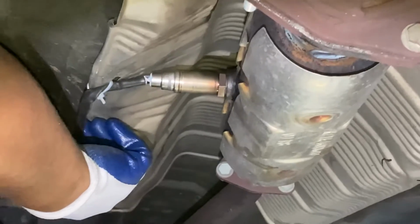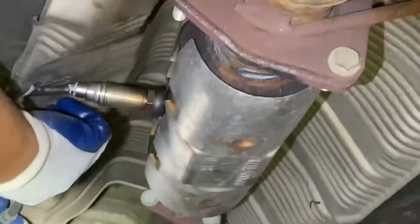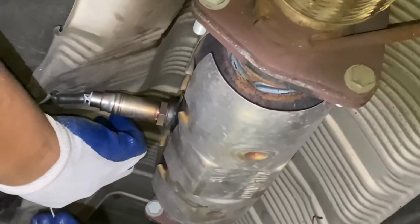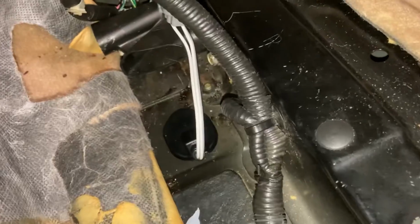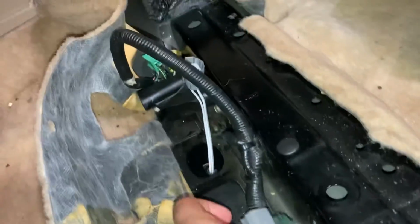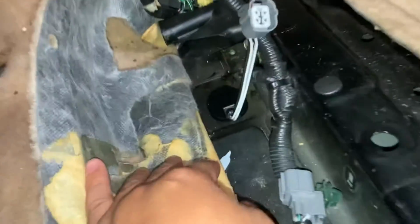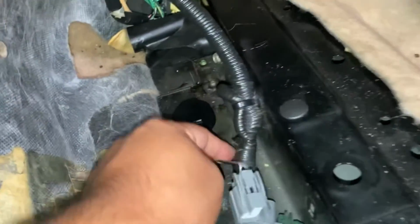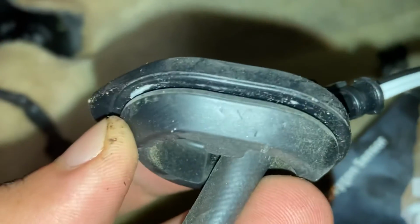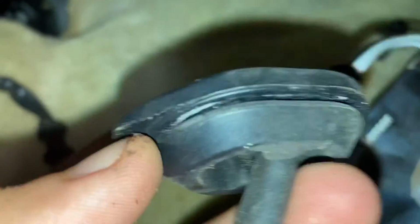I think you use the wrench, I think size 10, like the battery. Yeah, it depends on the car, probably. But you just put the zip ties and that's it. After zipping this, you just attach this O2 sensor, the tip of this thing. Just make sure it's very tight right there, because you don't want water to come out right here. And here's a cord. Make sure one cord is looking this side and the other one like that. And then you can see this thing should pass in the car in the metal. So this thing should be inside this bottom part.